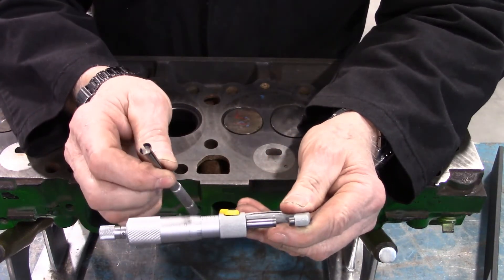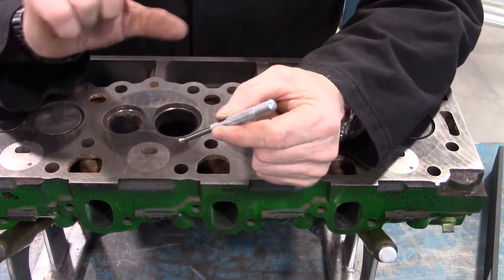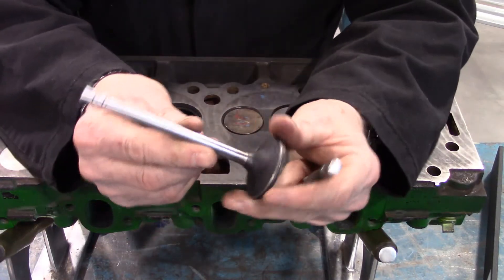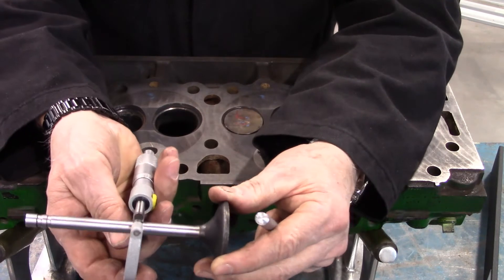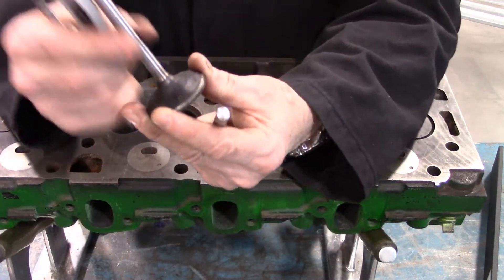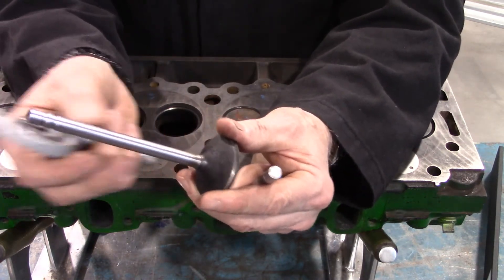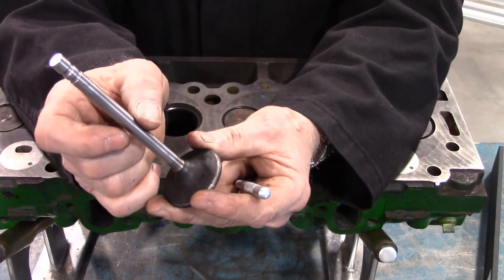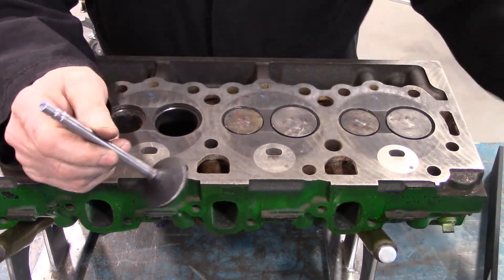Write it down — that's the most important thing. We're going to make that measurement in three positions along the length of that guide. Then in the valve that sits in that bore, we're going to use the micrometer and measure it in three positions along where it rubs. Don't go outside of where there is wear on that valve guide or you won't get a true reading. What we're looking for is the difference between my valve stem and my valve guide. That clearance is for oil to be present between the two components — it allows for lubrication and the removal of heat. An excess amount of room will allow oil to be drawn into the engine and end up either burning in the exhaust or at the intake valve.